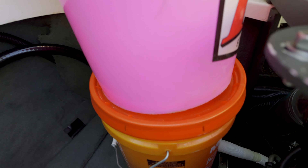Now we're putting the fuel stabilizer in — we're going to put it all in. I try not to have a lot of gas in there during storage, but most people actually tell you to fill it up completely. The reason for filling it is that the air in your gas tank heats and cools during storage, and it'll pull in moisture. You get more moisture in your gas if there's more air space, so a full tank reduces that.